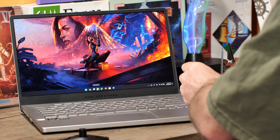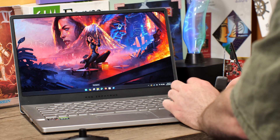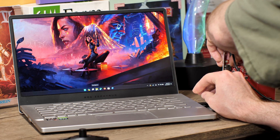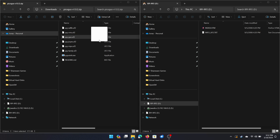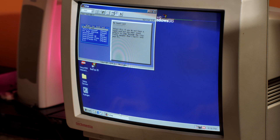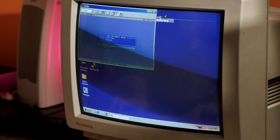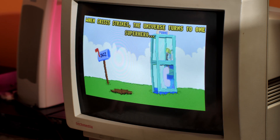Now if the thought of flashing firmware all the time sounds scary, it's not really an issue since the card can easily be restored if it gets bricked. If you hold down the boot select button on the PicoGus and plug it into a PC, it will show up as a removable drive, and then you can drag and drop firmware onto the card to restore or update it. It should go without saying that this card is designed for DOS programs. However, you can still use PGUSINIT to play DOS games under Windows 95 or 98 if you wish — just keep in mind you will probably want another sound card installed to handle Windows stuff.